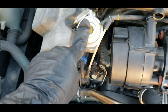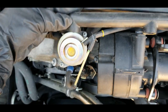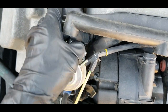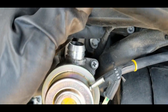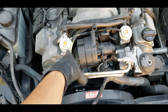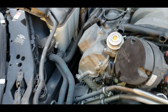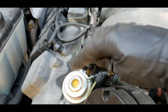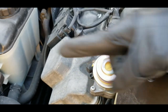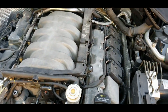The next step: there's a bracket held by just one bolt, I believe an E12, right down there. You're going to have to pop this off — which is not hard to do — and move this harness and the other harness out of the way, and you should see it right there. All you have to do is loosen it; be very careful, there is a gasket between the actual pump and the head, so you have to be careful not to misplace that gasket. I took the bolts out, lifted it a little, and pivoted it to the side — and I was able to take this puppy out. That's all you really have to do to replace this.